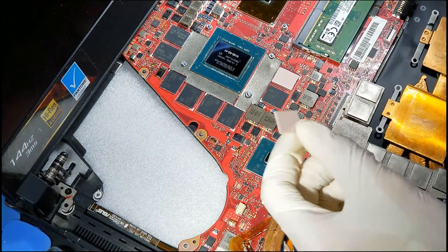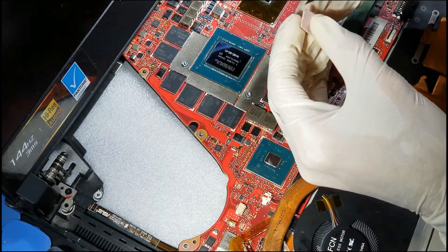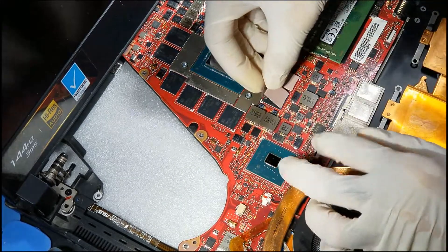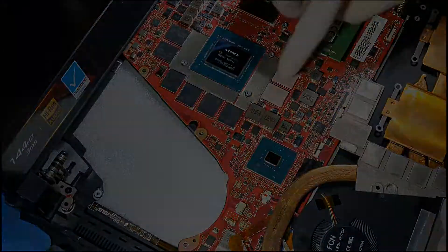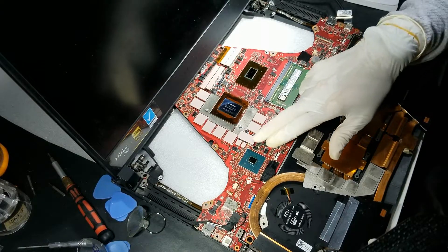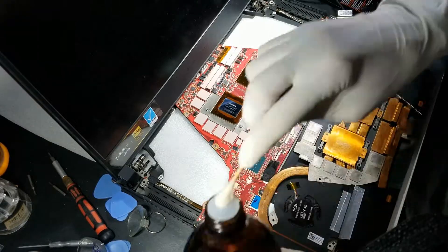The smooth face should be facing down so that it will be much easier to remove the cover. It is also recommended to use a sticky pad, which will make sure that the heatsink sticks to the GPU memory IC. If not, a quick solution is provided at the end of the video. You should get these results as shown — every IC and VRAM is covered with thermal pad.